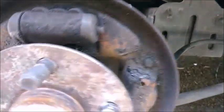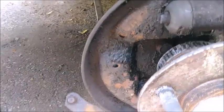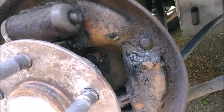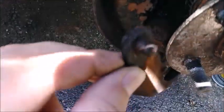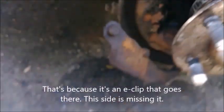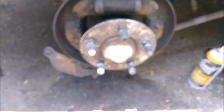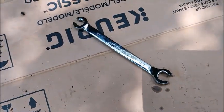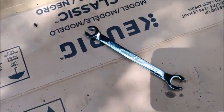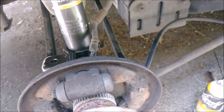Cleaned it up as much as I'm going to. We'll put some brake lube on those three contact points. Looks like there's a little groove for the parking brake piece — it's probably supposed to have a c-clip and this one doesn't, I'll look harder for one in the hardware kit. As for the flare nut size, it's gonna be 10 millimeter. Unfortunately my sizes go from 9 to 11, so I'm going to have to use a regular 10 millimeter wrench and hope the liquid wrench soaked in enough to get it off without stripping.